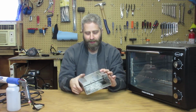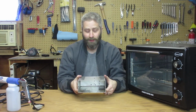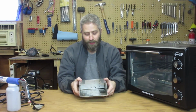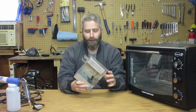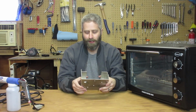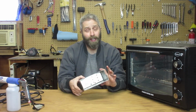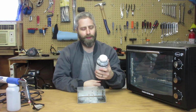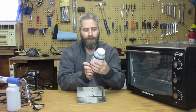And I think it's a great candidate to actually test out this system to see how durable the powder coating is, because if you recall, it sits pretty low on the bike. So the reason why I'm doing it is definitely for cosmetic reasons, and because over time this aluminum box is going to start to oxidize. So it makes it a good candidate for powder coating. So the powder coating that I'm going to be going with is this satin black hot coat from Eastwood.